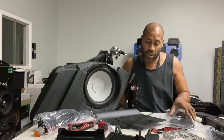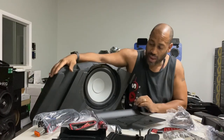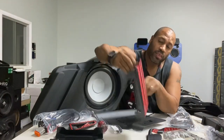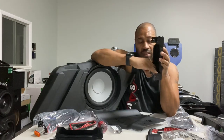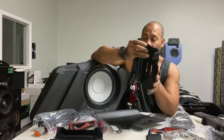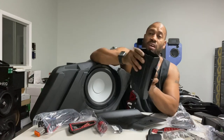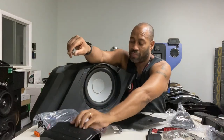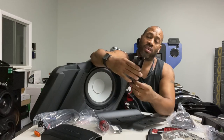This piece goes on the inside of the bag after the amplifier is mounted. The amplifier mounts to the back of the bag with a bracket lined in double-sided tape. The amp slides and locks into the bottom, and then there are two screws on top that hold it in place. Then you slide a really good-looking cover on it and you get an OEM factory fit and finish. This is the quick disconnect that goes on the outside of the bag.